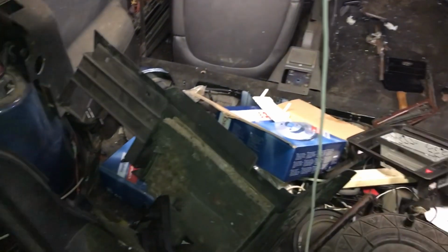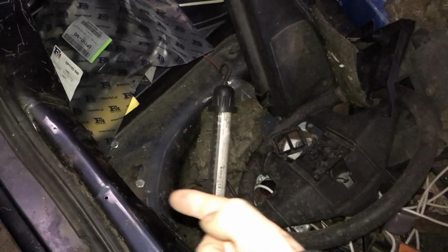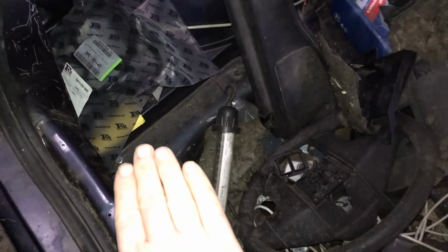Yeah. So I have the hangers that actually hang the exhaust system on a nut and bolt, with the idea is if I run a nut and bolt down here, it'll keep them taut and keep them in the right position, and then get a second nut and you can run it up and down, and you can then set the heights of the exhaust system. And it was the fastest and easiest exhaust system I've ever fitted, because if you're slightly wrong, you can tighten the nut from underneath and the exhaust will come up or down a few mil, and that is absolutely perfect. So that's what I'm doing for the exhaust.